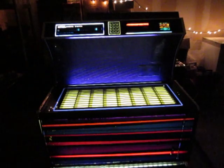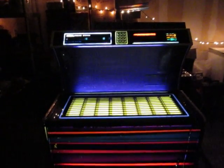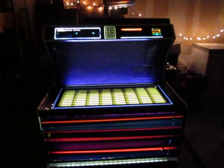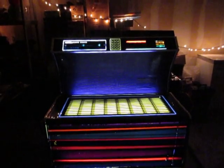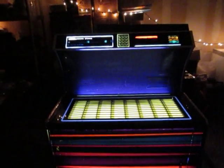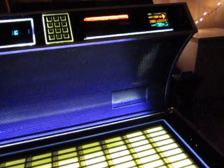I picked this up from some sweet lady. They played it for eight years and then when it stopped working they put it out in the garage for a number of years, and that's how I found it. She thought it just needed a fuse, but what I really found out is that the only thing they ever did to it was push the buttons — they never did any lubrication or repairing. The motor and all the internal mechanisms seized up from gunk and lack of oil, all that old lubrication that turns to glue, and it actually broke the motor coupling in half. So I went in and replaced the motor coupling, lubed and cleaned, and got rid of a lot of varnish.